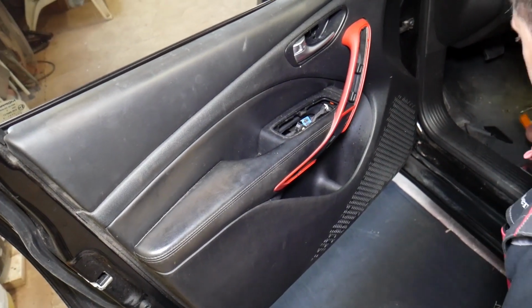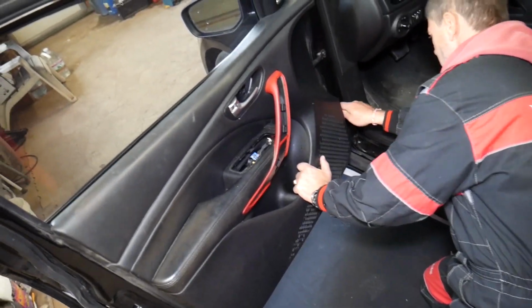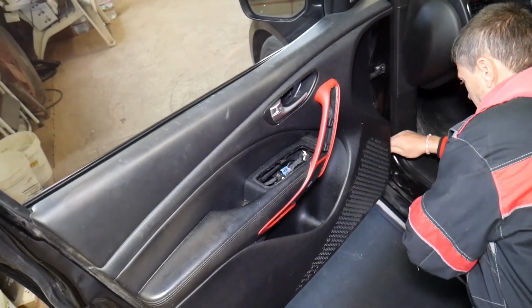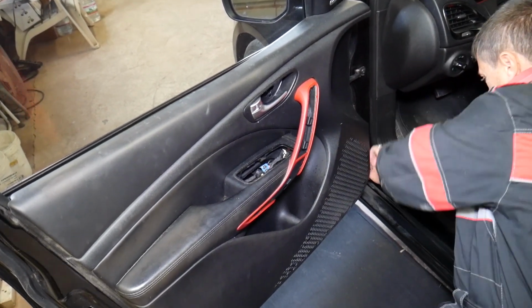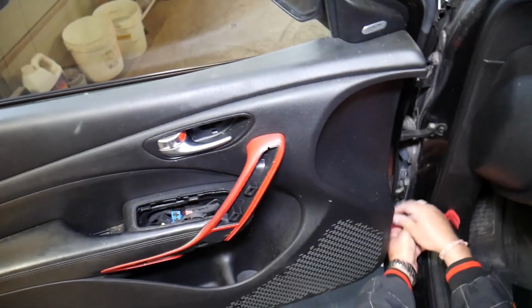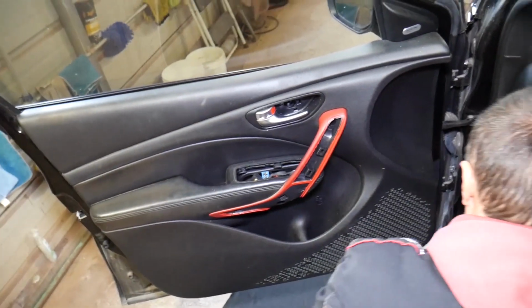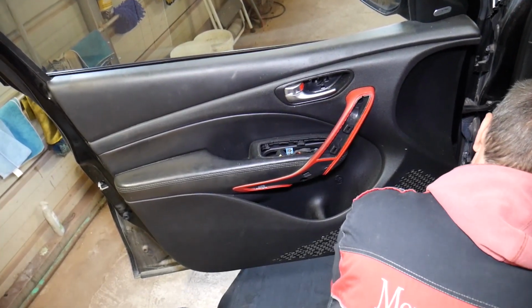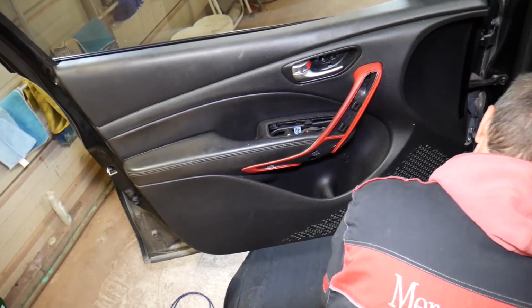Perfect. Now we get a plastic panel removal tool. We should have only the clips holding that in place. So what we're going to do, actually, we're going to get it between the door panel and the door itself, and you need to pry. Okay, perfect. Now if any of the clips break, it could happen, guys, especially if they're super tight, or sometimes if they're old, the plastic will be more fragile. We'll have the link in the description of the video below to see where you can buy new ones from.